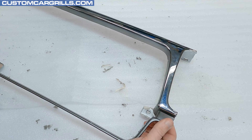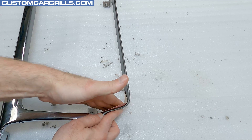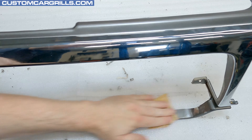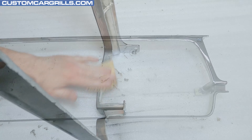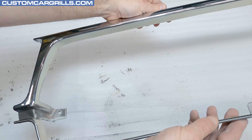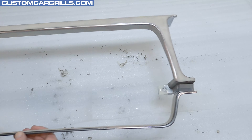It's now time to move on to the sanding of the inside edge of where the frame was gutted. There are a couple of high spots from the old bars and some 180 grit paper will make short work of getting these areas flat. If you wanted to keep the front of the grille frame chrome, it's best to just tape off the finished surface before performing this step. I had planned to color swap this frame, so I'm going to start working the paint and chrome off. Pneumatic tools such as a dual action sander will speed this up considerably. Here's how my frame looks with a mostly sanded inside edge.